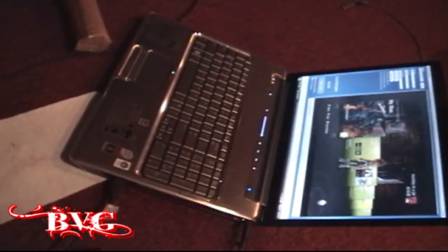Here's your HD PVR. First, run the power to your power strip. Here's the USB — you can use any high-speed USB cable; I have a nice Belkin 6-foot so I can keep my laptop where I sit. At the bottom are the HD inputs — you keep all your inputs that you would normally run to your TV, then take the dual-sided HD component cable and run from the HD PVR output to the back of your TV.